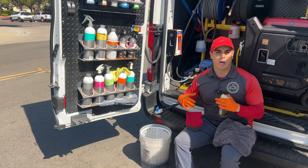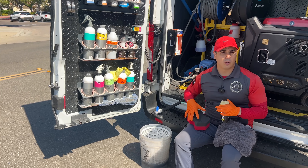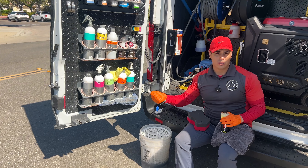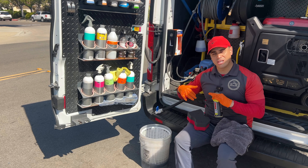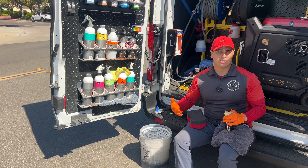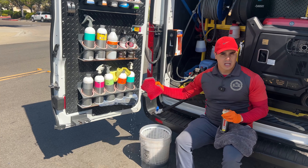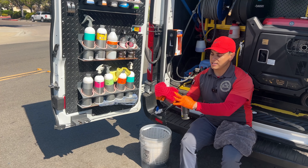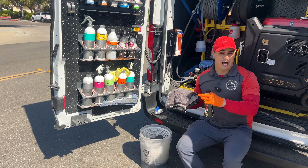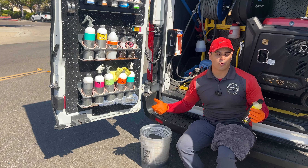So how is it different from the traditional wash? Well, in the traditional wash, you would have your bucket with your soap and then your sponge or mitt, wash the vehicle, and then the soap residue is on there. Then you take your hose or pressure washer to rinse off, and then dry. With rinseless wash, you don't have to do that last rinse step — you can just wash the vehicle and then dry it. The best way to do it is to pre-treat with some of the solution, let it sit for a little bit, then take your sponge and glide and clean it. The sponge also has grooves that trap the dirt and keep it in there. Then take your towel and dry it off. It has a lot of lubrication, so it's safe and it won't damage the paint. And that's basically what a rinseless wash is.